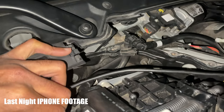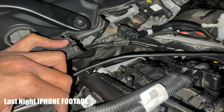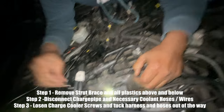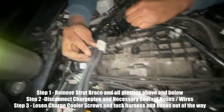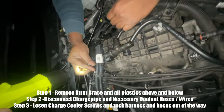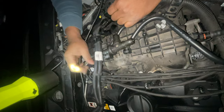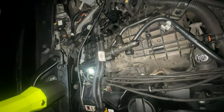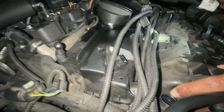This is the best I could do — salvage some iPhone footage and walk you guys through what we did. First step: we removed all the plastics, like the ones on the cowl, exposing the brake hardware, brake booster and stuff like that. And also on the other side, that exposed the positive jumping port. Both of those have to come off. Underneath it is the strut brace, and underneath that is a little plastic cover that blocks the rear of the engine — all has to come off.